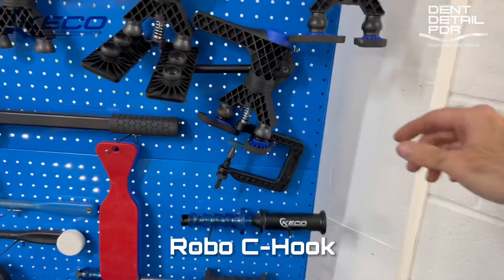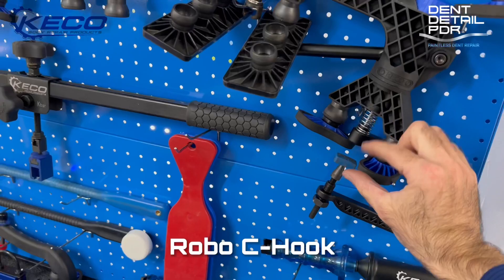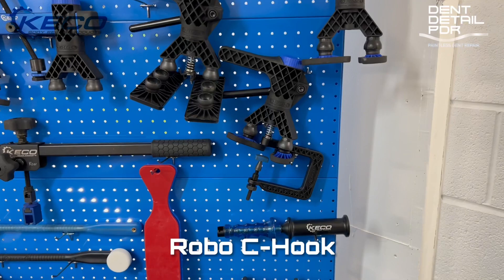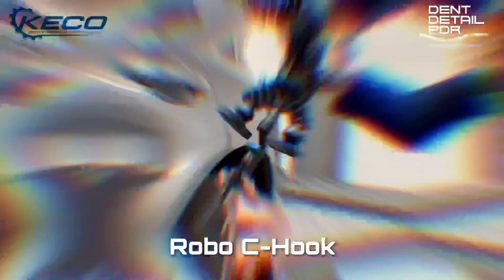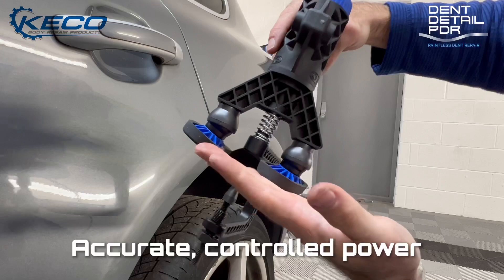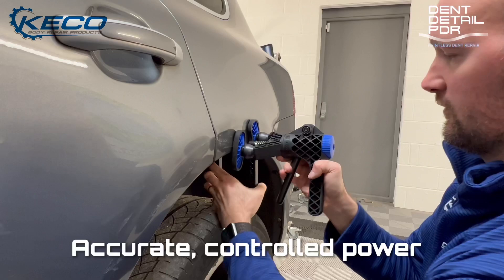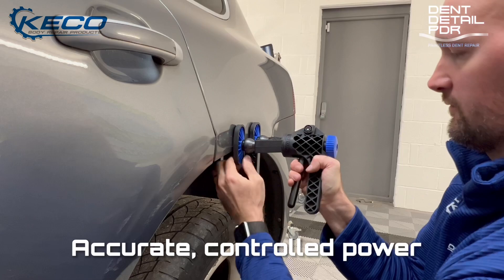One of the main things added — which got a lot of feedback — is the C hook. The C hook is great for edges of panels. If you've opened a door and it's whacked against a wall, putting a kink in the edge, this will squeeze it back into place. It was on the old system but wasn't already attached to a robot — now it comes ready to put straight onto the robot. The tip goes behind the back of the panel; when you pull the trigger it brings it all up into place, and the feet keep the outside of the panel in place. Great for door edges and back panels — just tilt it on the back side and squeeze, and it'll bring it all up. Really powerful for back doors as well.